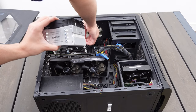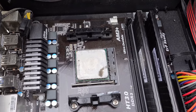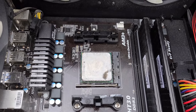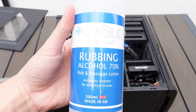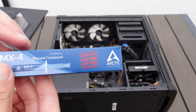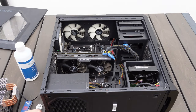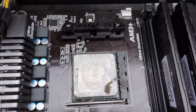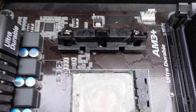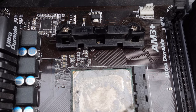Let's start cleaning this PC by first removing the heatsink and fan. The heatsink is looking pretty bad so I don't think we'll be using that later on. We'll use a Q-tip and some rubbing alcohol to clean the CPU and heatsink, then apply new thermal compound so it works hopefully well. Looking at the heatsink, the clips have completely broken on one of them - this is why the heatsink won't stay on and the fan won't stay on either.